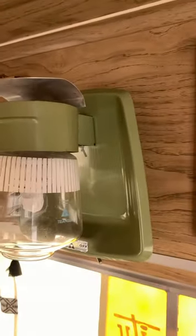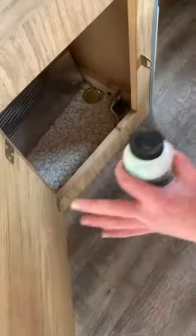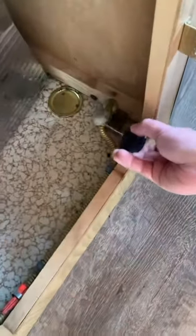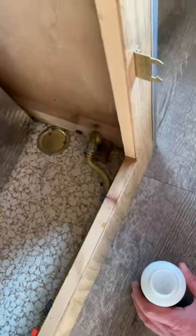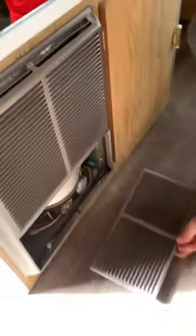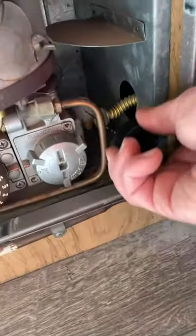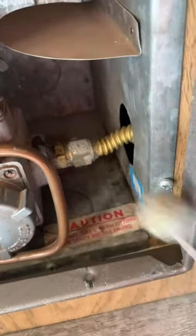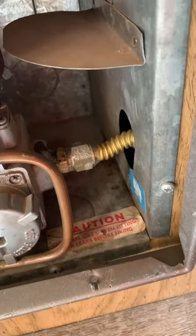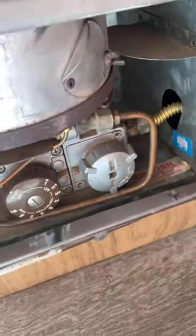These lamps here — there's no real way to test the fittings on them, so I just smell around them. Then the heater is the other thing. The heater has a connector right here that comes up through the floor. I like to put plenty of the leak detector liquid on there. I don't see any propane leaking there. I'll also check the connector where it goes into the heater. Little bubbles are fine; big bubbles are not. That looks fine.